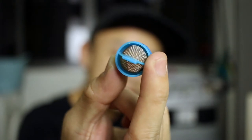Over here we have our Samsung washing machine — I'll leave the model number below so you know what model I'm using. When this issue happens, you want to make sure you check everything: there's nothing wrong with your water outlet, your hose, or even your filters. Your filters look like this and they shouldn't be blocked. Check all of this to ensure they're all working before you isolate the issue.